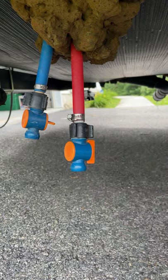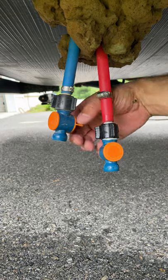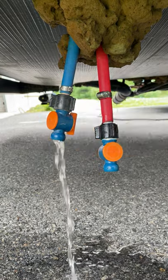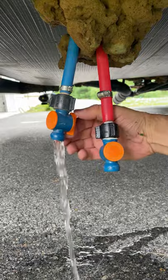They're rated to 100 PSI, and along with your fresh water tank, you can now easily drain your pressurized lines and your water heater to drop some weight before leaving a camping trip. Which also means you're getting old water out of your RV so you can put fresh water in there for your next trip.